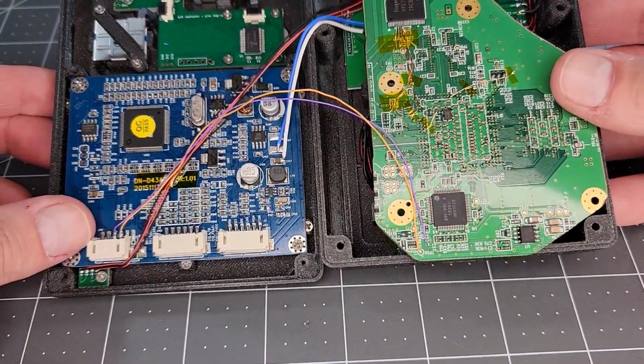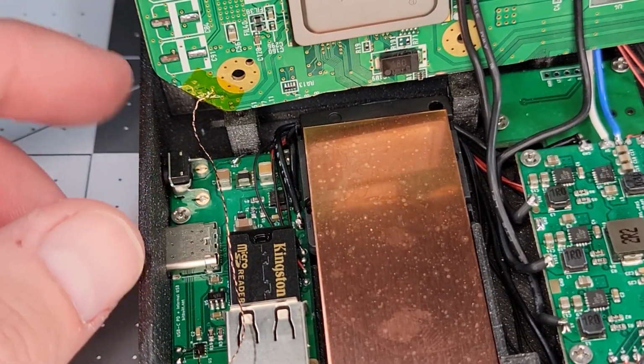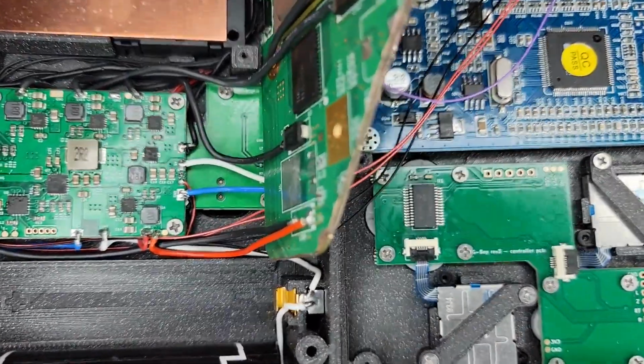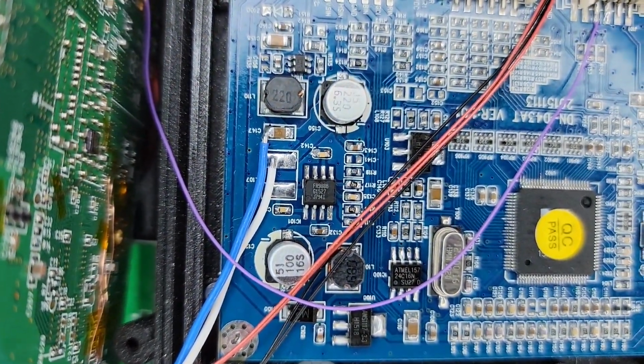Next, the video connections are made with this purple and orange wire pair, followed by the USB connection made with the fine 34 gauge wire in these locations. A quick and important note is that I had an error on the screen power wiring previously where both were connected to the 5 volt line. I've remedied that, and now the blue wire is properly grounded.